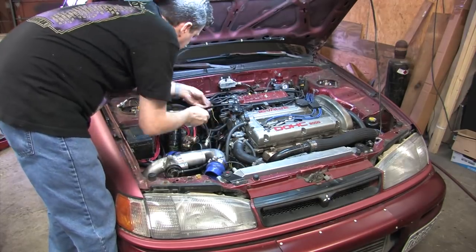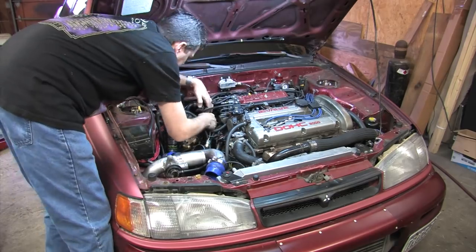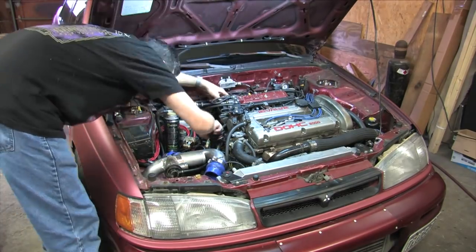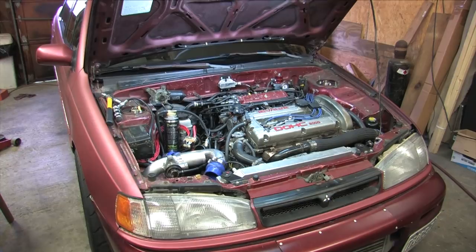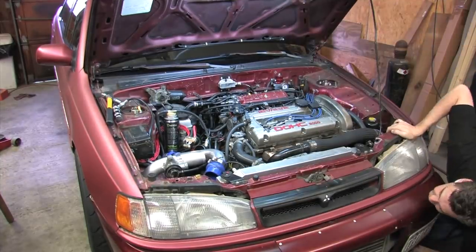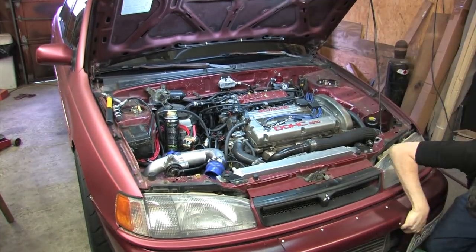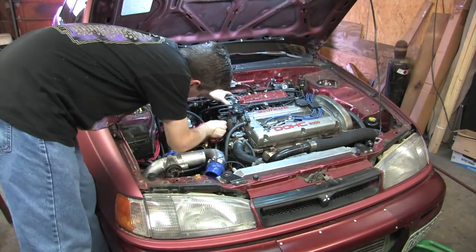On every car equipped with a fast idle air valve, there are coolant lines that run to it. Coolant doesn't evaporate and it loves to short out electrical circuits. Ask me how I know. You'll need to drain the coolant level lower than the throttle body hoses anyway, so about a gallon works. Different year cars will present different challenges for this, and my Elantra doesn't apply to any of them, so let's get to the meat already.